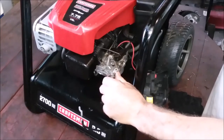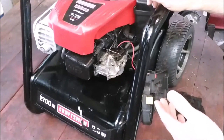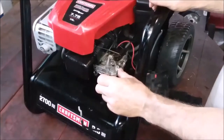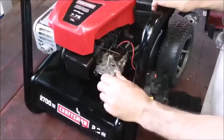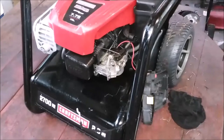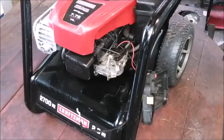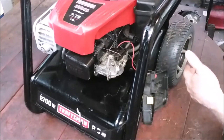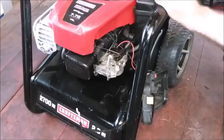And it will pull more throttle. And when it's not sensing the pressure, it'll release. So one of the problems that can happen is these things get stuck. So let's just try it again, and we're going to work this manually. All right, you can defeat that. I did on my other machine. You can plug it off because the cables go bad, the actuator gets stuck. All right, so let's see what happens. Let's restart it.